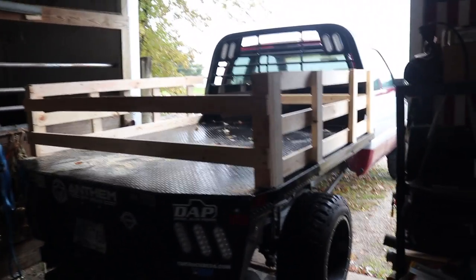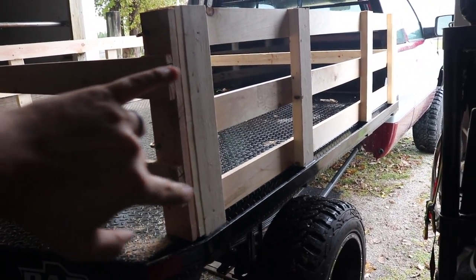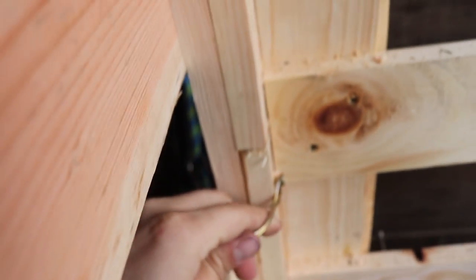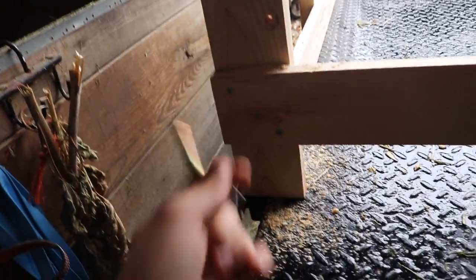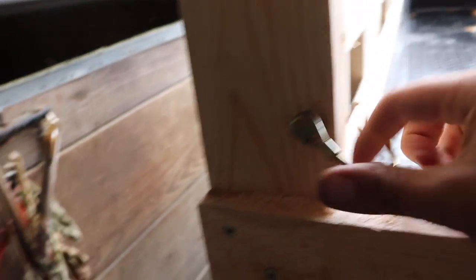Here's the framing work for the flatbed side railings and back gate. I haven't painted it yet — I'm going to paint it black so it matches the bed. There's a three-board side railing and then I did a two-board back gate, spaced out to be perfectly aligned with the two gaps in the middle. The way I'm containing this is with pins. These pins poke out just enough on the back so you can latch them on — it's not going to come off going down the road. You have to give them a little push for them to come out, but they pop right out. The pins are just the right size so there's no slop in the rear gate.